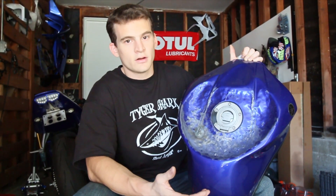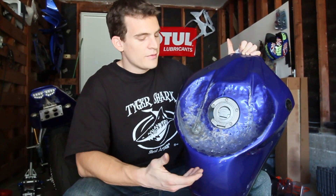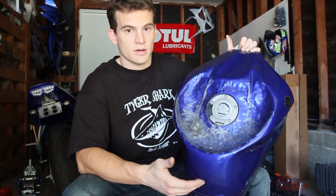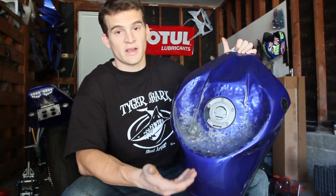Most people's first reaction is to Bondo it up in order to fix it and make it look good. We personally never use Bondo because using Bondo takes away from the lip of your dent, and you want to have as much lip as possible to hold you in as well as possible. If you don't use enough Bondo it'll crack away easily, ruining whatever paint job you put on top of it. And if you use too much Bondo, you circle back into that problem where you're taking away from the lip of your tank dent.